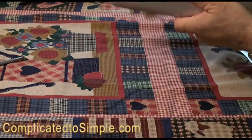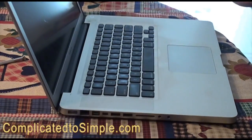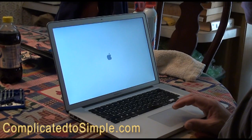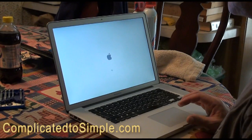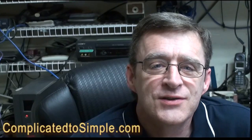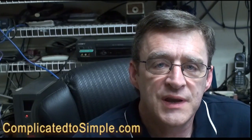We're all done — just flip it over and open it up. It works just fine, and you can already tell it's running much quieter, like it was when it was brand new, instead of the loud fan noise I was getting before I cleaned it out. That's how you clean the dust out of your MacBook Pro. Today's repair was done with a number zero Phillips screwdriver.